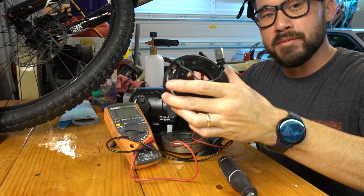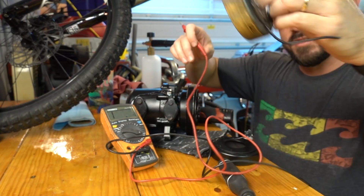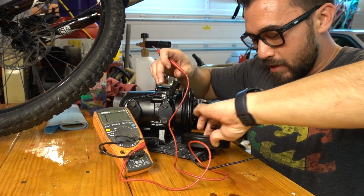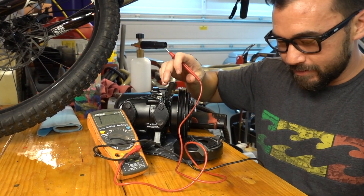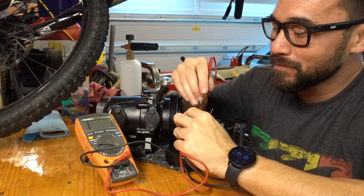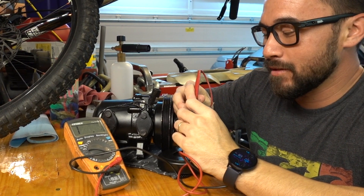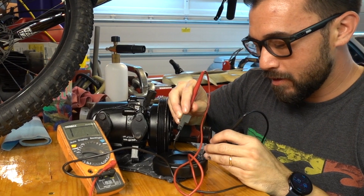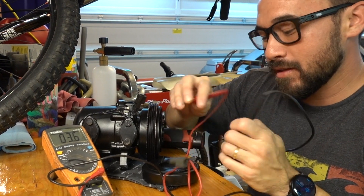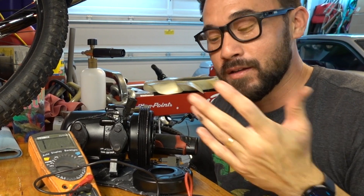Here's my brand new replacement one for the Skyline. This one reads a little bit different as far as resistance goes - it's actually really low. This is a super Japanese part. These coils are known to fail on the Skyline - my car is 30 years old but only has about 60,000 miles, so these compressor coils are really just fragile. I'll hook it up to the terminal and ground it out - we're looking at 3.6. These things are pretty fragile over time; the resistance ends up going down and you end up popping fuses.